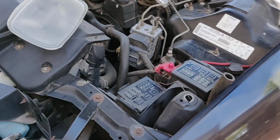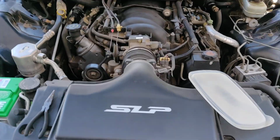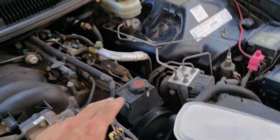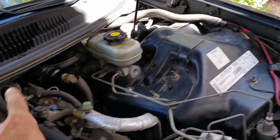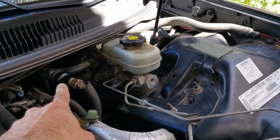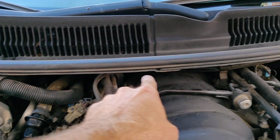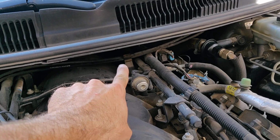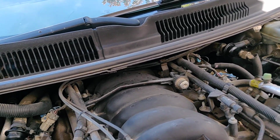But to back up a little bit, so I have that code. The code just means, in general, the system's not working. And so, with the exception of the pump, you have the wiring, and you have that tube sticking up there, and then that tube over here runs around. And it basically goes into 2 check valves. One is here, and the other one is here. So there's the rubber tube, and then there's a solenoid back there and an air diverter valve, which is what splits the one output from the air pump into 2 different outputs, two different check valves.